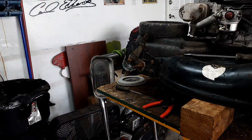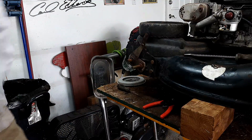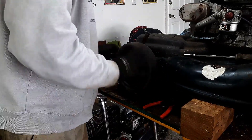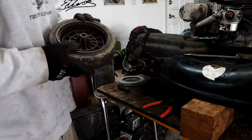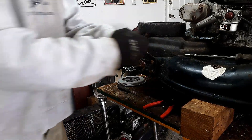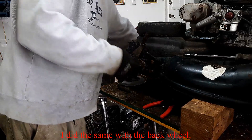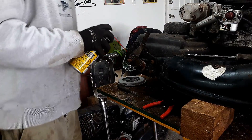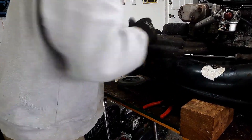I'm just going to clean this shaft up now. There's no way I'm ever going to get it perfect. Let's see how this wheel fits on there. I will put a little bit of lubrication on this — some regular all-purpose grease, not very much though. Grease does attract dirt and just becomes a bad gob. I also have to do this adjuster as well — this one looks just as seized as the last one. Sometimes looks can be deceiving.